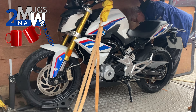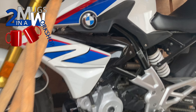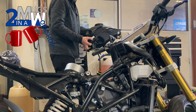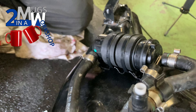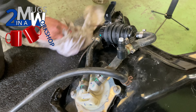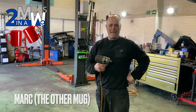We took a huge gamble when we bought this BMW G310R off eBay — untried, untested, with no recorded mileage. Tank off, and there was a lot more fuel in there than the one bar on the fuel gauge gave credit. New fuel filter is on. I've just took the spark plug out with the old air gun.